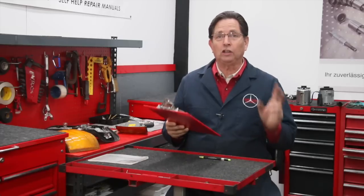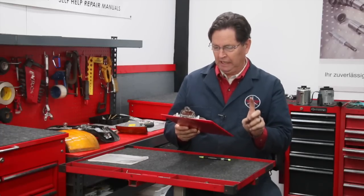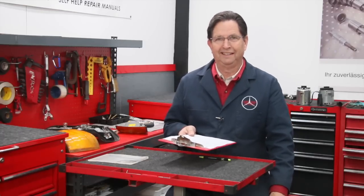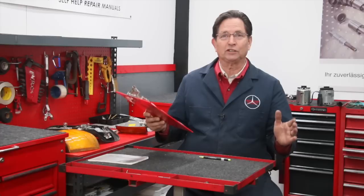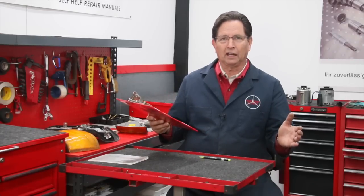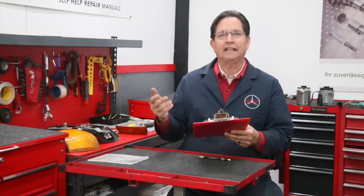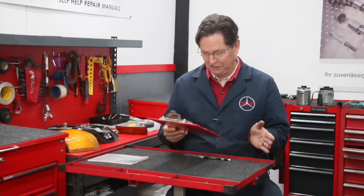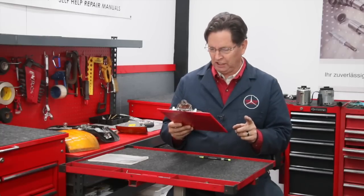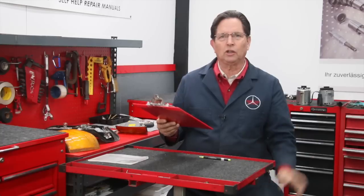The next question — actually two combined — is about lubricating a sunroof. First: how do I lubricate the sunroof on my W124? I don't think I could answer that in an hour-long reply because I've done a complete set of videos on how to do this — it's over two hours long. It's not something that's easily done, and the reason is you have to remove the sunroof panel to do proper lubrication. The second question: he has a 1978 W123 non-tilting sunroof and the cable broke due to poor lubrication — he only hears clanking on the C-pillar with no movement at all, even trying to move it with the emergency crank in the trunk. If the cable is sheared or broken, even the emergency method won't work.